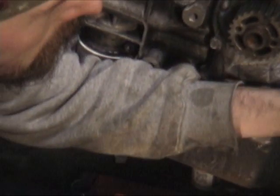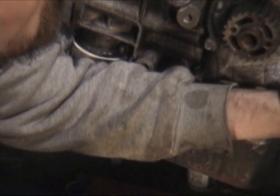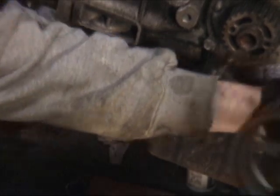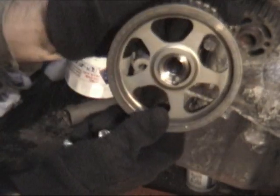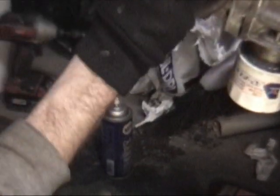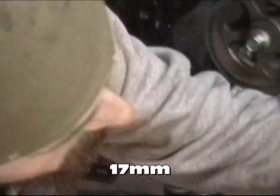Generally, left to right is referring to sitting from the driver's orientation. So if you're standing behind the engine and looking forward, this would be the left side. We don't have those reluctors on there, so this is the right side here. Make sure you double-check that if you get confused, because obviously these hash marks line up right against the cam sensor the same way as these hash marks line up right against the crank sensor.